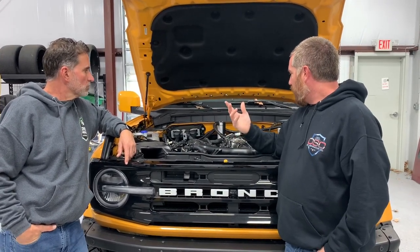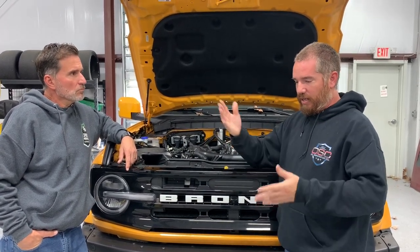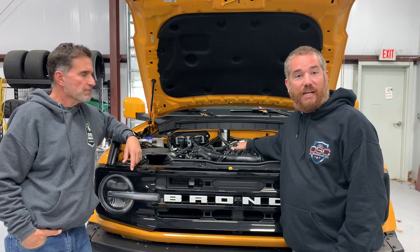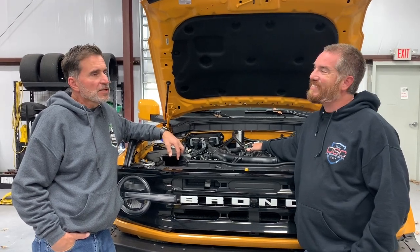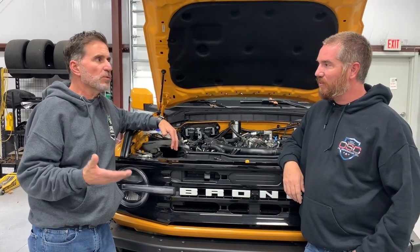So this happens because the crank, the rods, and the pistons are moving very, very fast inside the motor, going through the oil, and you're getting splash and foaming. What the normal PCV system does by keeping that negative pressure is keep that at bay, but of course it also draws in that vapor. Yeah, so drawing that vapor out of the crankcase and into the intake presents an issue when it's direct injection.